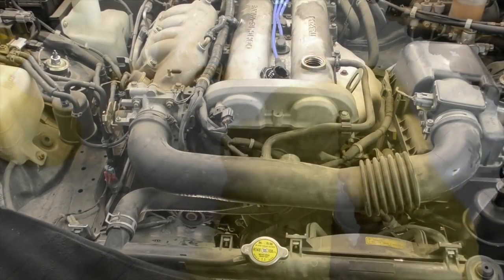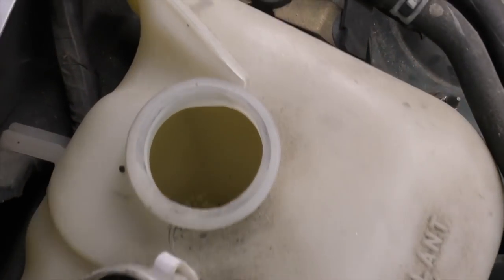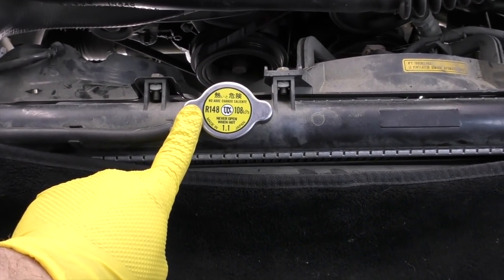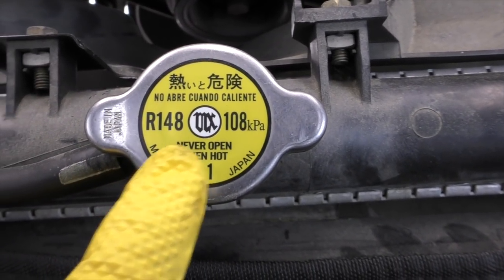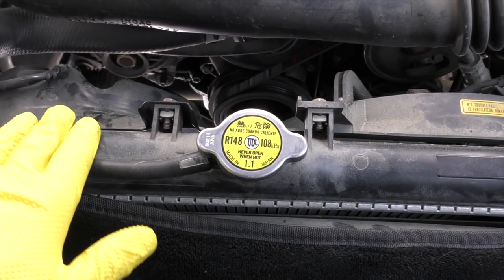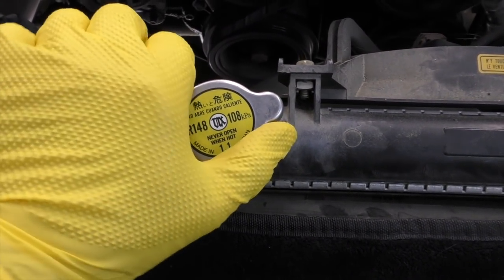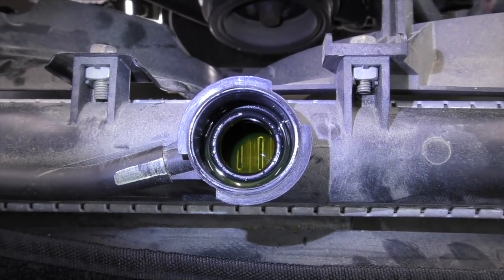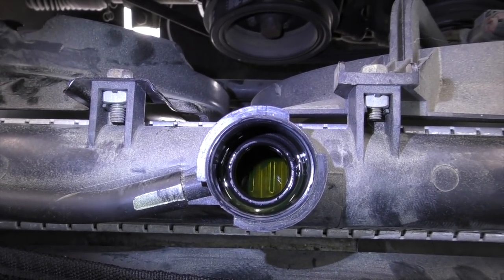We're going to take a look at our coolant next. We'll look at the fluid reservoir — based on the outside it looks like the level's right, but unfortunately it's just super dirty, so we may take this off and clean it. If your car has a radiator cap, we're going to pull it and inspect it. Very important: never open when hot — that is a good way to get yourself severely hurt. Our car's been sitting a couple of days so the engine's not even warm. The coolant doesn't look too crazy, so I think we'll get away with just a drain and fill.